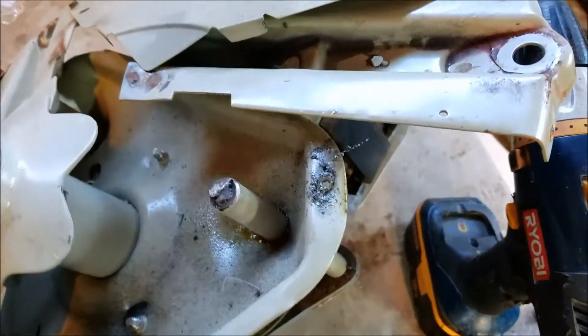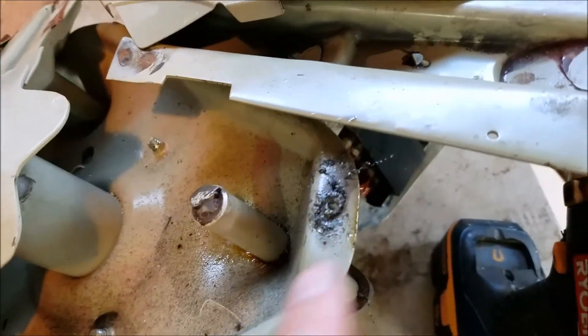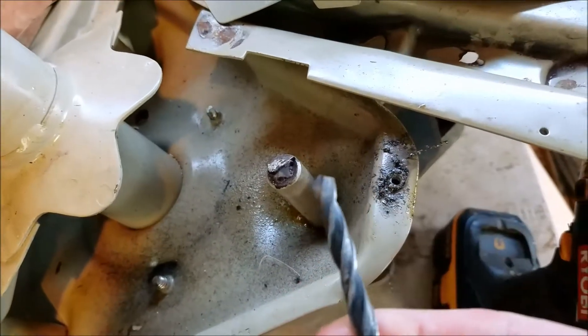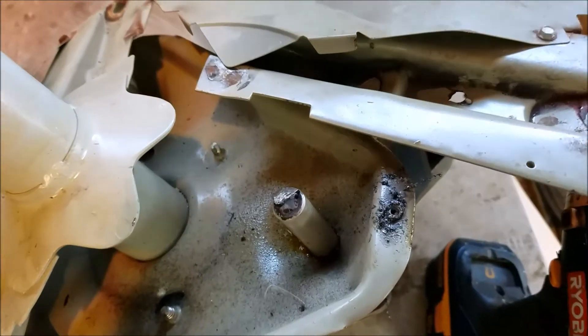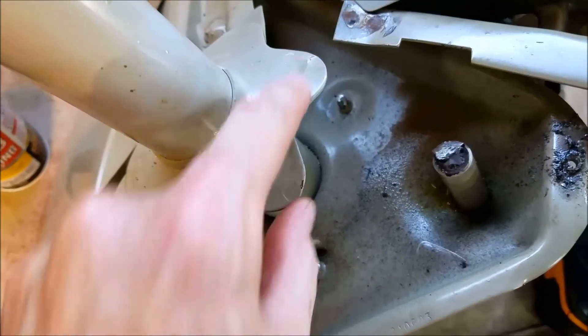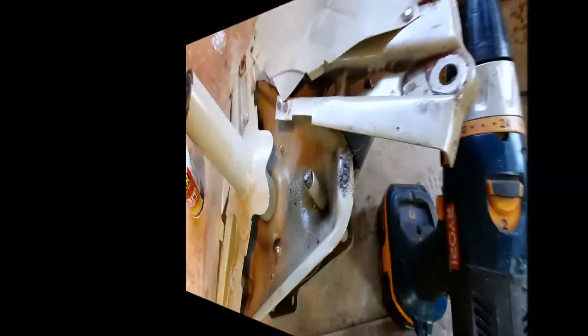Here's the update. Drilling through an old spot rivet can be difficult, so I've used a small drill bit to get me a pilot hole first. Then I got me a quarter inch bit I'm going to take through and get my first bolt in it. Then I can work on these spots up here to get those drilled out.